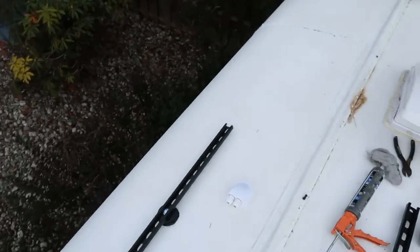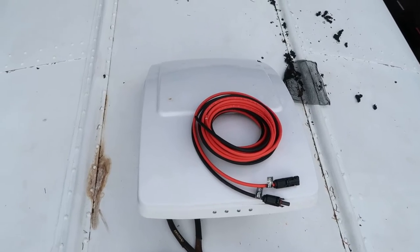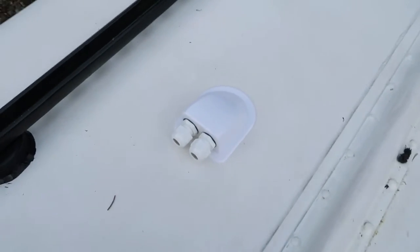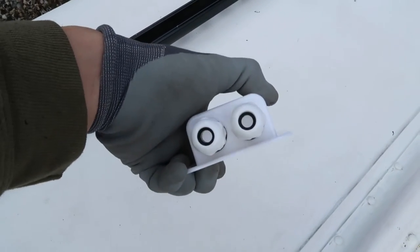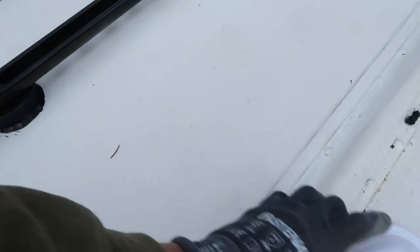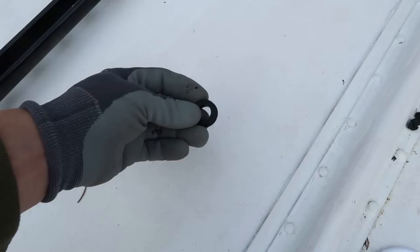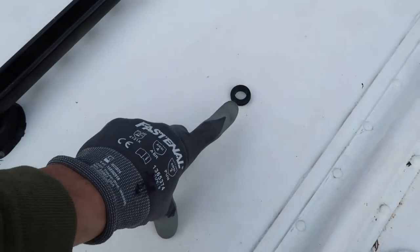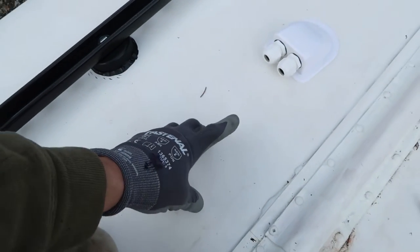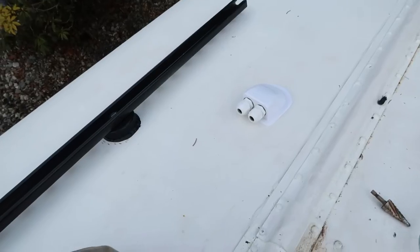The last thing I want to do is route the wire that's going to connect the two ends of the solar panel array — we're going to feed it through the roof through two spots. We'll drill one single hole, put a rubber grommet through, then feed the two wires through so they come out with enough length for the solar panel array to attach to.